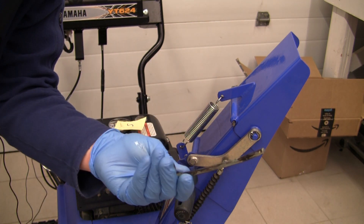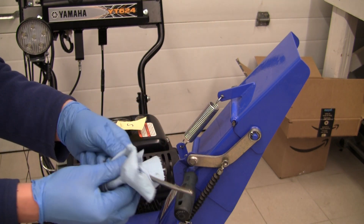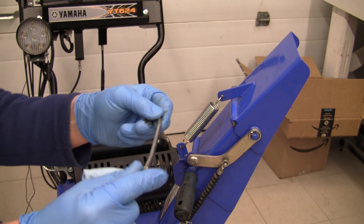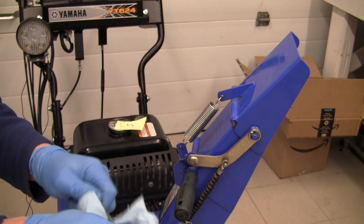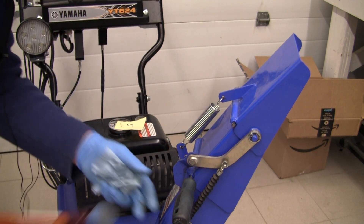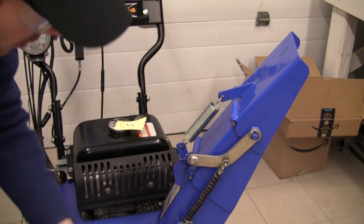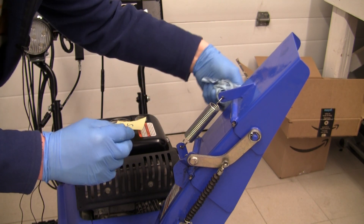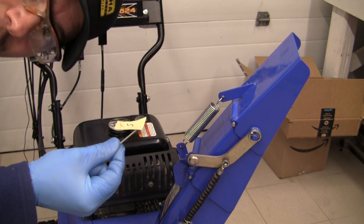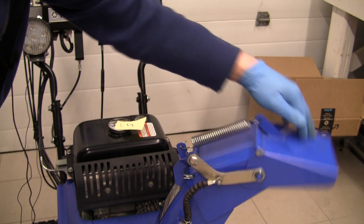Number two pin is out — it has no corrosion, a little minor amount of dirt, so we're going to give it a clean. The pins are not straight; they have a bit of a bend in them — that is not a defect, I think that's to keep tension in the mechanism. We're going to put some grease on there and stick it back in. While you're pushing the pin in, leave the screwdriver in so that it guides it back. At the end, wipe up the grease, then go ahead and put those cotter pins back. The Yamaha book says to use new cotter pins, so we'll use new ones, but they won't be from Japan.